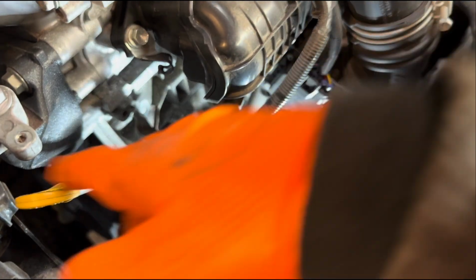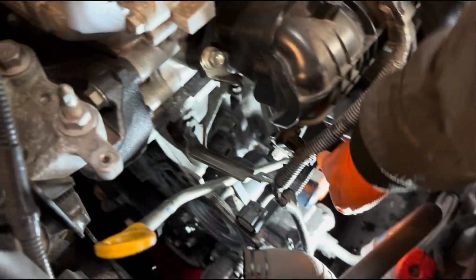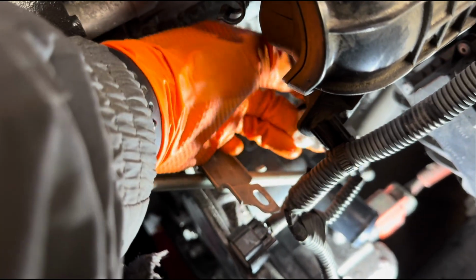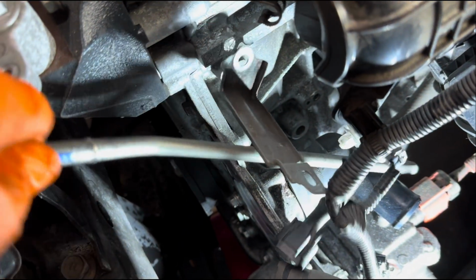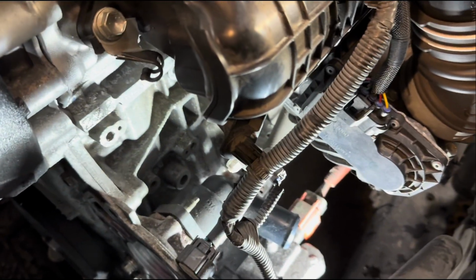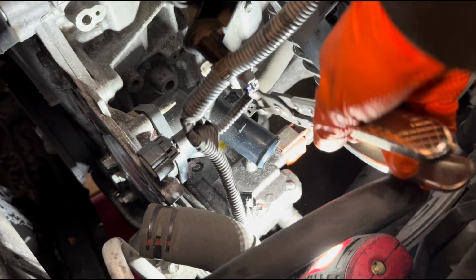Okay, the dipstick does come out. You just need to be a little bit persistent, wiggle it around like this while you hold it from here and pull it out, and it will come out. And this cable here, this little thing that's just plugged in the side there, you just need to release it. You can then get this dipstick out a little bit. We can then hopefully, although I already moved that hose a little bit, it'll be a lot easier to do it now.